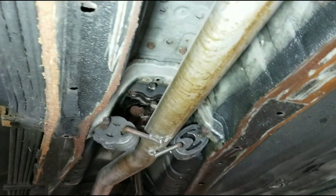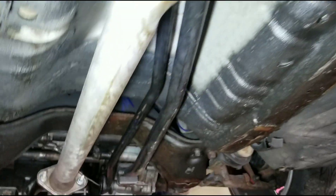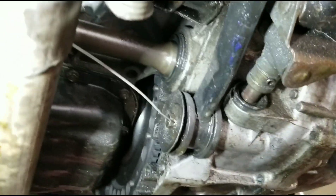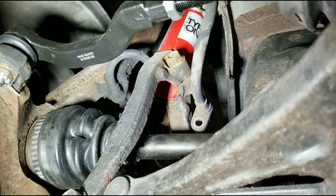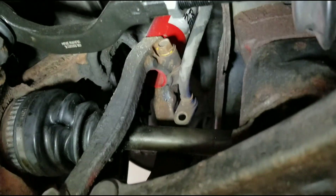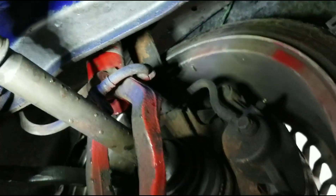We also see it's all oil that was burnt on. Getting a little closer, we can see it's definitely leaking some kind of fluid — kind of hard to pinpoint because it's all over the trans. Looking at the ball joints and tie rods, he's got some cotter pins in there which is always a plus. Making sure the bolts look tight, anything that could pose an issue — we don't want a wheel flying off on the dyno. The brake line is not secure — that's a big deal. It's not rubbing on anything right now, but you still want to secure that stuff.